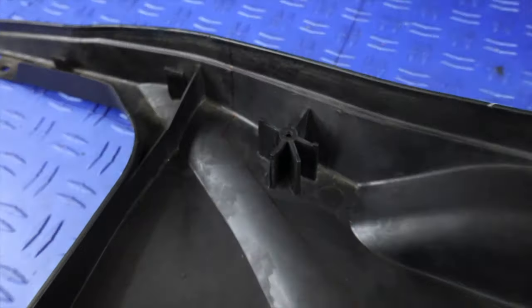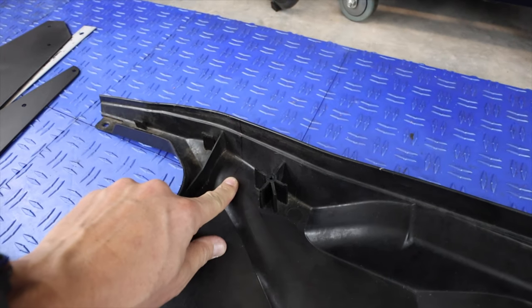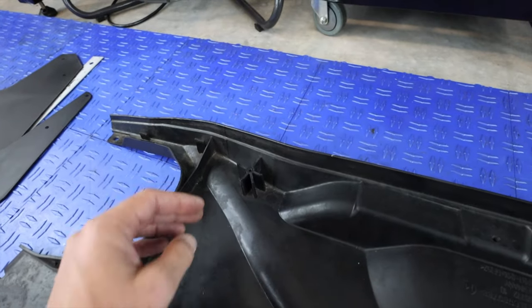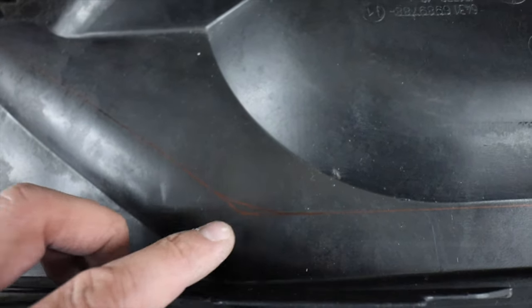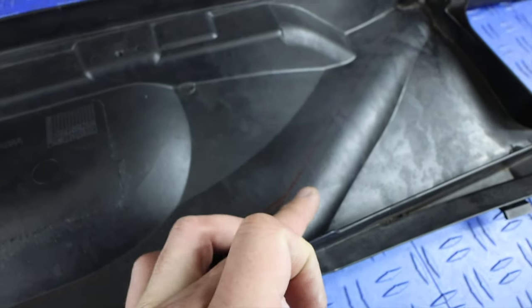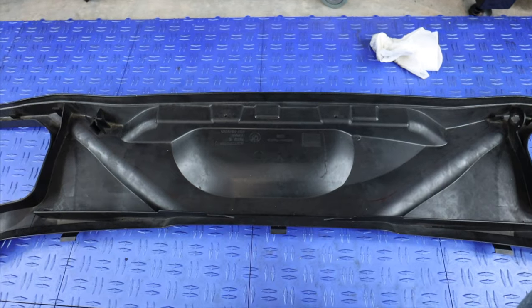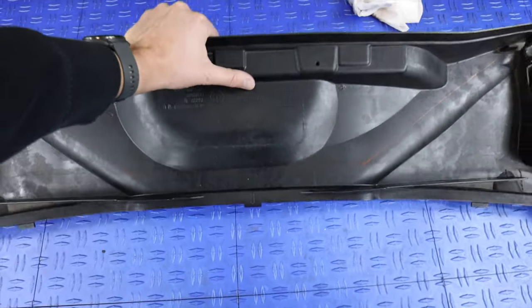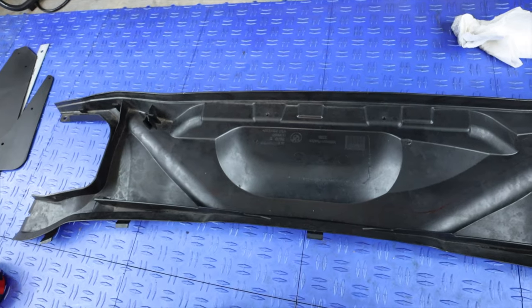Also when doing this, you want to keep in mind that water likes to pool in through here. You see there's a little lip - when water comes down the cowl, it actually makes its way into here. Part of the reason we're leaving this little lip and putting a rubber gasket is so the water doesn't just simply fall off on top of the engine. This way with a little lip and the rubber seals, the water still has places to go and drain out in the proper locations. I recommend just leaving a little bit of a lip here along the line and keeping it as clean as possible. You'll be able to keep all of your seals and won't run into any water issues. I did some rough measuring and I think this is going to work pretty well. I'm going to round off the corners so it's not a harsh corner - that way the seals will fit better. We're going to go ahead and use a Dremel for this, hoping it'll work because this feels like a very thick piece of plastic.